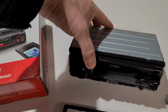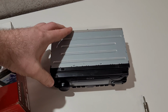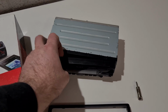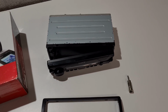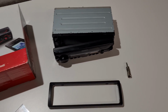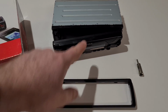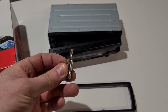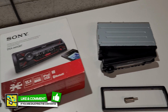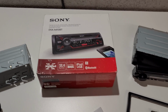Here we've got the lovely Sony Edge unit. I'll show you that later when it's all lit up in the car. It looks a lot nicer than it does now. This head comes off with the button press there and you can take it out. I don't personally take mine out because, like I say, they're not something people go for anymore. People used to break into your car and steal your CDs and stuff like that, but not anymore. Times have changed. This is a surround which then goes around the outside of that, which makes it look pretty, and this is just a converter to convert the Citroen aerial to go back into the Sony MP3 player. That's the model that I've got. It's a DSX A410BT, and again I'll link everything in the description below.